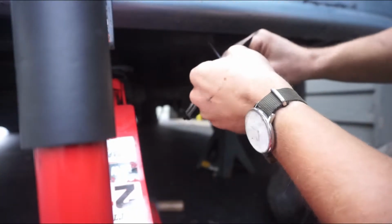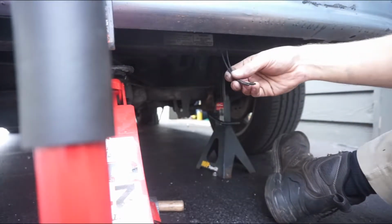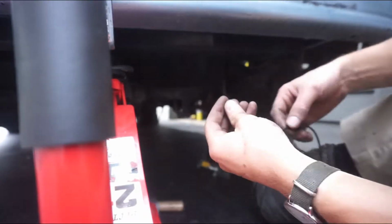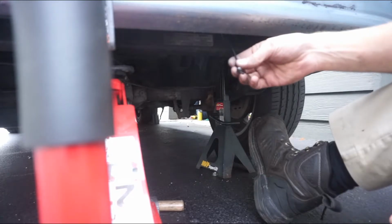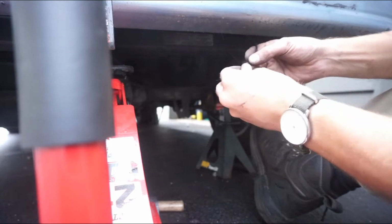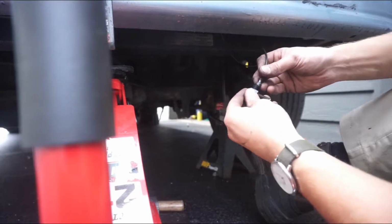It's gonna eat through that pretty easily. There we go. Now that you got your hoses here, take your little rubber washers off your little donuts, and then you're gonna take one of these, put the space shuttle tip on first, and then you'll run the donuts in, and leave about an inch. Maybe 3/4 inch, like so. And then I'm gonna put it in.